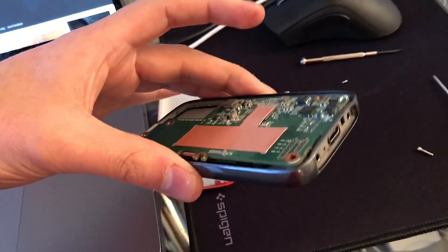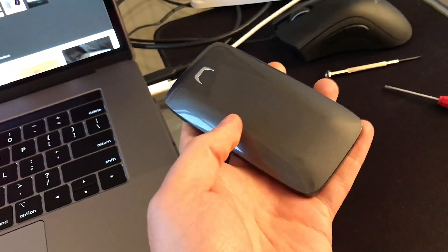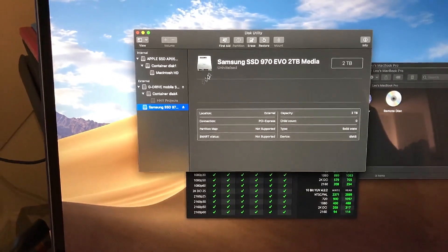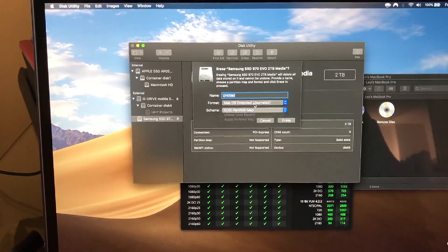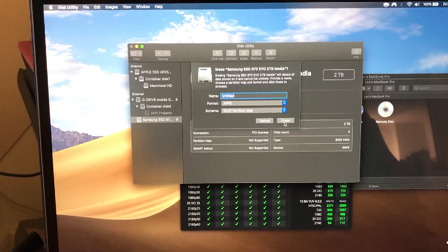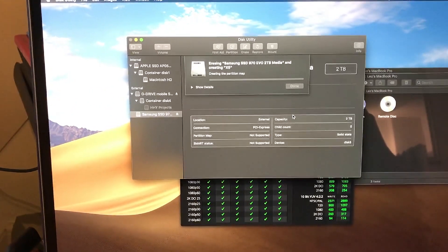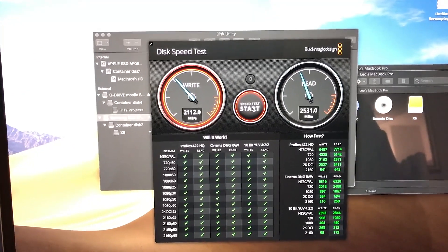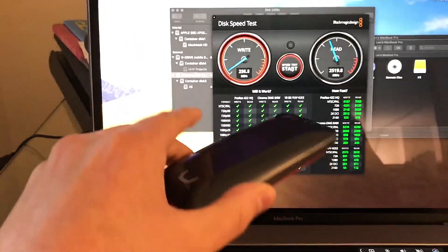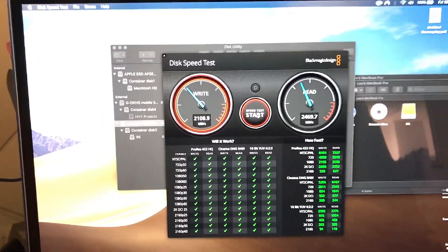It's very easy — you just slot in the Samsung Evo; there's only one way it fits. We put everything back together, turn the board upside down, put it back in, and replace the five screws and the bottom panel. That's the old drive we can sell on eBay, and we have our upgraded drive for less than half the price. When you first attach the drive it will probably ask you to initialize it, so we format it using Apple APFS format, name it X5, and run a speed test. Funnily enough, we're getting about 100 megabytes more on the read and about 50 megabytes more on the write compared to the drive that came pre-installed.